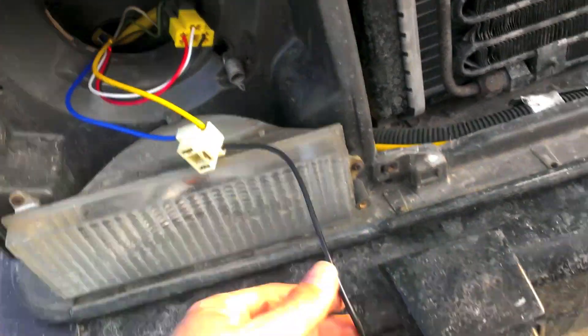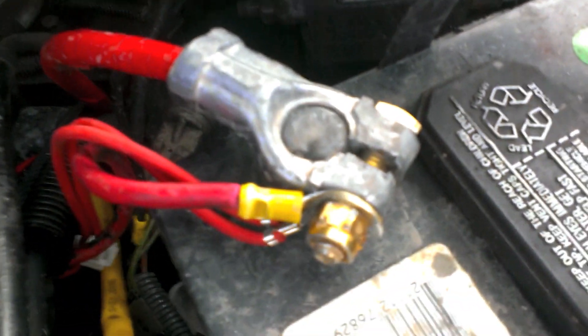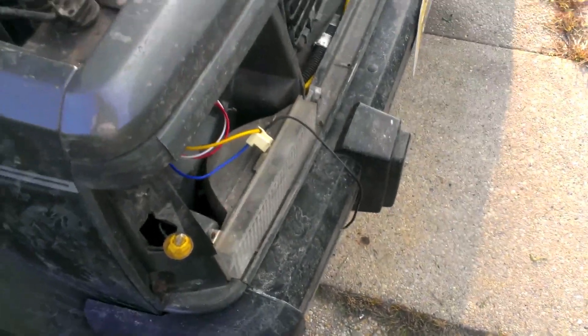You've got this one, which I just have to ground somewhere — same with the other one. I have it run up underneath the air conditioner line. The relays sit there for now and they're going to keep sitting there unless I can figure out how to hook the bracket up. Then they run this way to the side of the battery and positive cables right into there — crunched down nice and tight so we've got a good connection. Once I ground these, we're good to go. Then it's just cleaning up with zip ties.